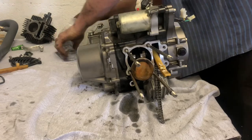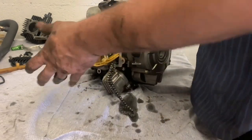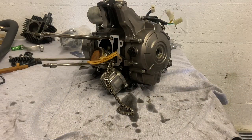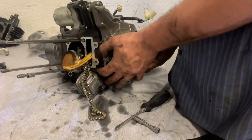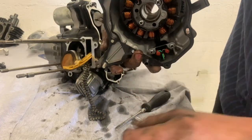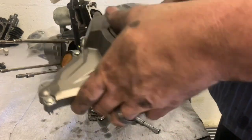We're in here. Now we're gonna pull our side bolts off the cover. I got all my bolts out of my cover here. You gotta pull it — it's gonna want to pull back in because it's magnetic since you have your pickup behind here. So I'm gonna leave all my bolts in this cover and just lay it out since I got room on my table.